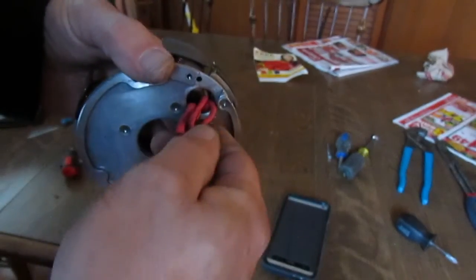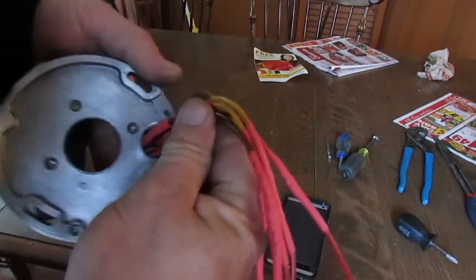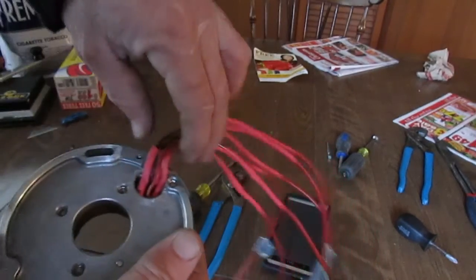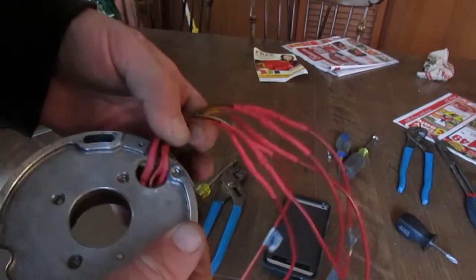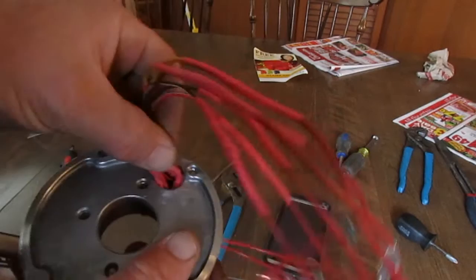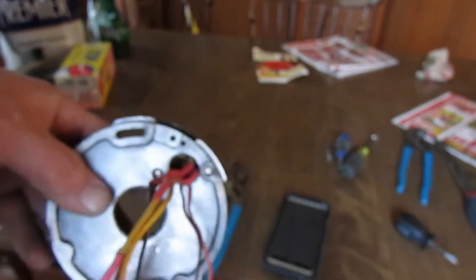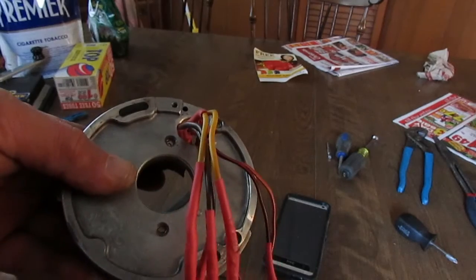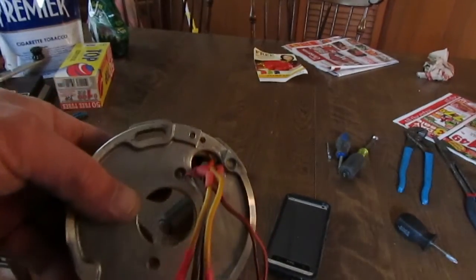As you can see, the hole is much bigger and there's much more play in there. That whole problem of wires coming through too tight has pretty much been eliminated. I'm going to finish heat shrinking these wires — small heat shrink on the individual wires and then heat shrink the whole bundle together. Maybe I'll even silicone it up to help keep moisture out. The problem with sharp edges nicking stator wires or ignition coil wires is gone, eliminated. On any motorcycle, snowmobile, or ATV, this is one of the first things I'd do if I suspected electrical problems and went to the trouble of pulling the stator.